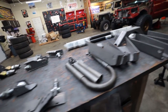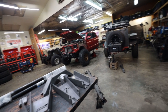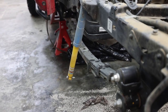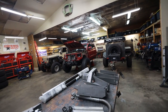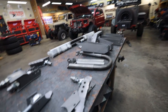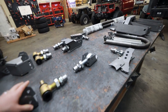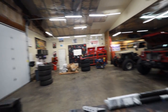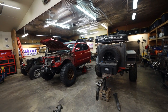The three-link is going to flex way better than the factory leaf springs, and we need to lift it. Everybody I called for custom leaf springs was looking at close to $2,000. Leaf springs are very expensive these days and everyone is super backordered, so I decided to go coilovers because coilovers are not much more than building a custom three-link as long as you know what you're doing and you do all the work yourself. We're going to the whiteboard to talk about our options for the Tacoma. But first I need to clean all the brackets off this axle housing and clean up a whole bunch of stuff on the back of this truck.